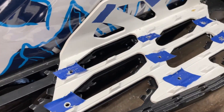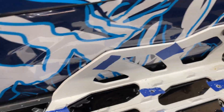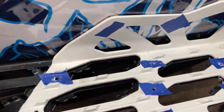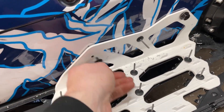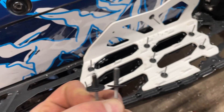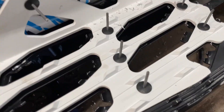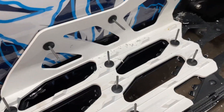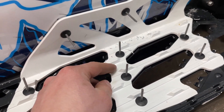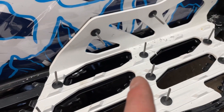I'm going to do the bottom ones first, hoping that helps pull this up and line everything up before doing the top ones — it all has to work together. There are some shorter rivets: four shorter rivets between both sides. Short ones go on the sides and the long ones go on the bottom — about an eighth inch difference between the two. To get this up I'm going to either clamp it or use a jack to push it up, otherwise the rivets will just pull through.